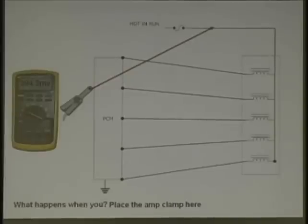So in order for you to read 3 amps on this thing or 4 amps, okay, you need a reading like this. Because that's really 3,942 milliamps, not 394.2. Forget the decimal. Does that make sense to everyone? So it's 4 amps. That would be close to 4 amps. That's correct. At 1,000 milliseconds, 1,000 millivolts, 1,000 milliamps, all equal 1. Whoever is from Europe, he will understand pretty easy. Yeah. But a lot of people here don't.